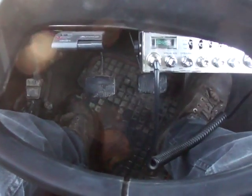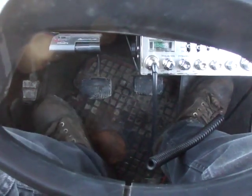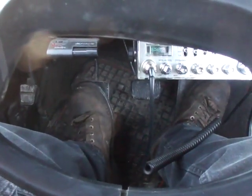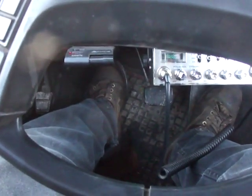For you guys with manual cars and trucks, if you get code 67, what that code basically means is the clutch safety switch. In order to not get code 67, you push in your clutch.